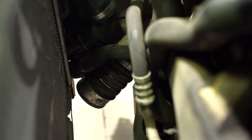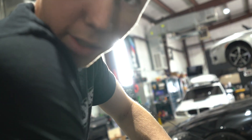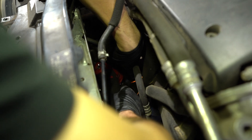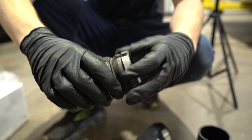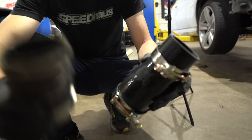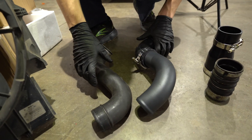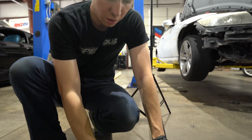Be careful — cut something else and you're gonna have a bad day. You can't go rip your car after putting your intercooler in. This is what we just cut off with the cutoff wheel — cut that band right there and after that this thing just slides off. Here's the replacement: from outlet to intercooler, and here's the replacement from intercooler to charge pipe.